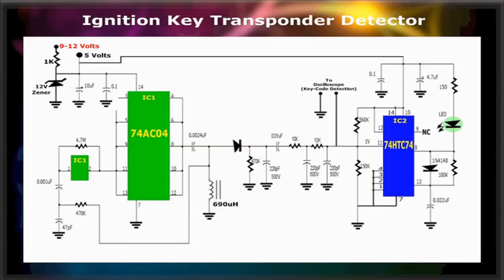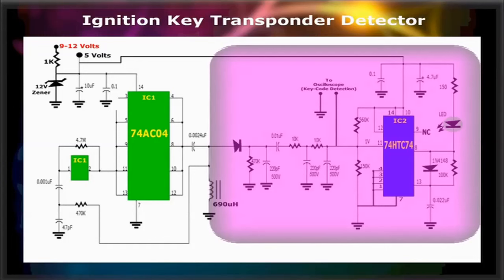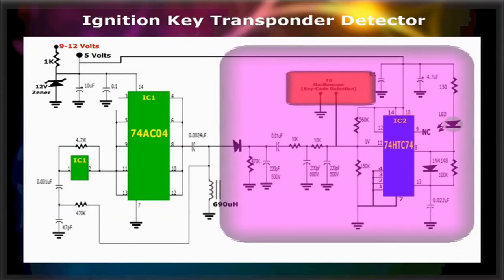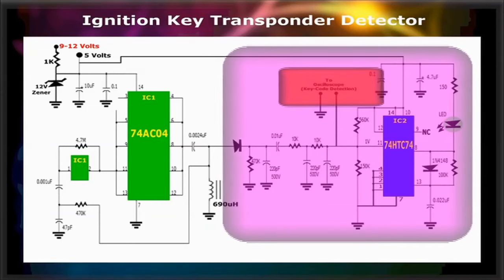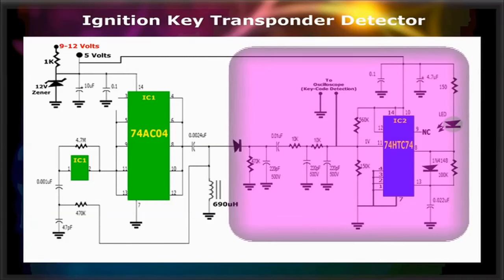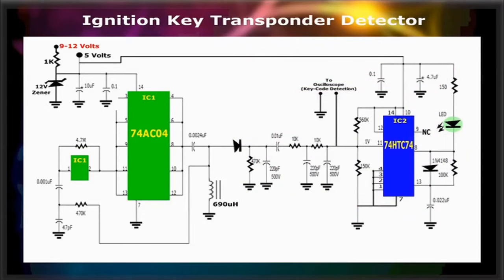The second part of the circuit filters out all the hash from the power generation part and carrier wave, and only leaves the pass code. At this point, you can feed the detected code to an oscilloscope and have a clear waveform view of the actual passkey code. You'd have to freeze the waveform to view the fast-moving digital code.